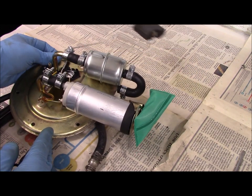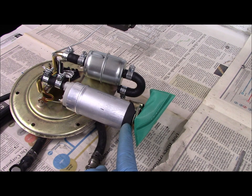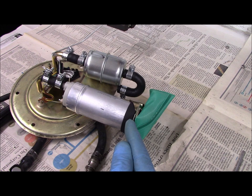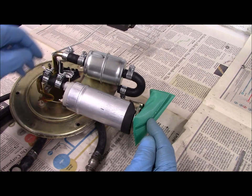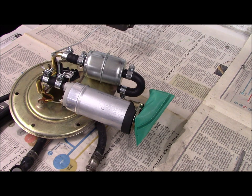All the clamps are on and they should not come loose under fuel pressure. The last piece I put on was the particle screen — it fits over the inlet to the fuel pump, and the vibration damper rubber goes on the outside of the metal circle on the particle filter. It's a little hard to get that to go in, but I found that if I took my small screwdriver and pulled a little bit on the vibration damper rubber to open the gap just a little bit, it slid in. Just be careful not to bend your float rod while pushing on the particle screen.